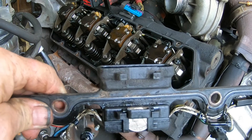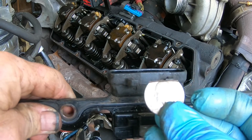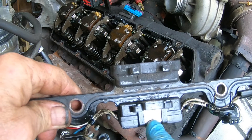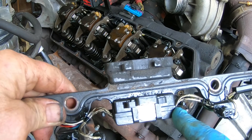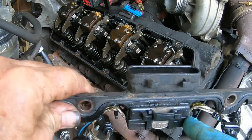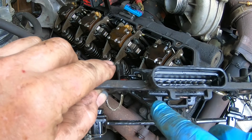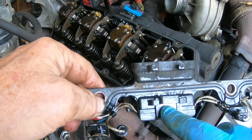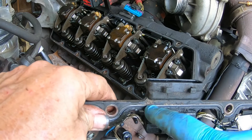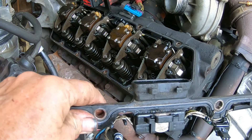International came up with a spacer to go inside of here, which just happens to be about the same size as a quarter. The quarter has to be modified a little bit — basically I just kind of shaved the very top of George Washington's head, and you slide that in behind this locking tab. That's what locks this connector in, and this connector is basically identical to the one on the outside. With that quarter in there, you can see these tabs are locked up, and gravity being what it is, the quarter can't fall out that way, and it can't come out the top because the valve cover is going to be sitting right there — once it's in there, it's not going anywhere.